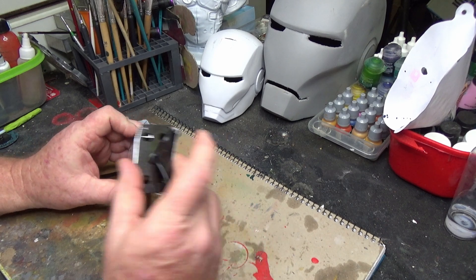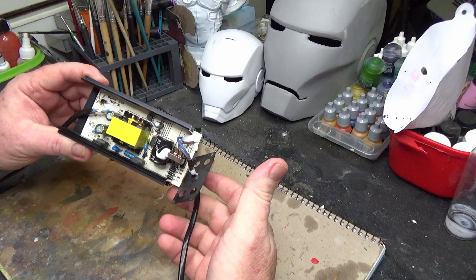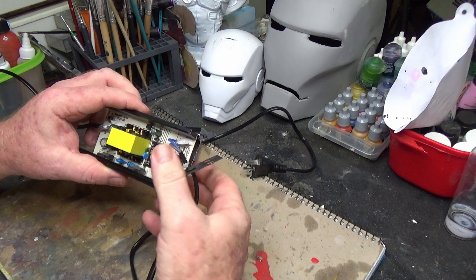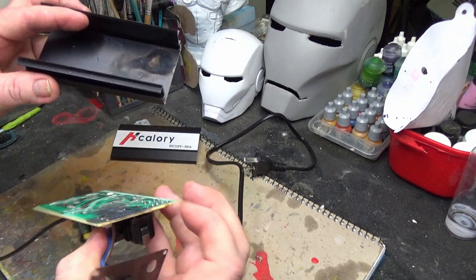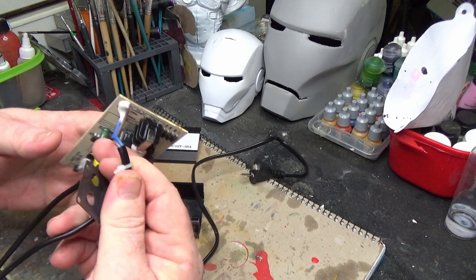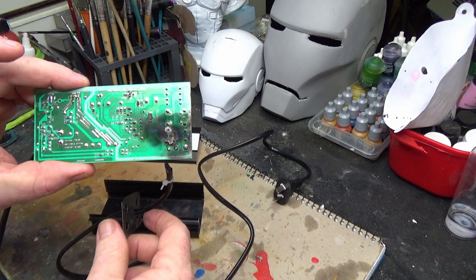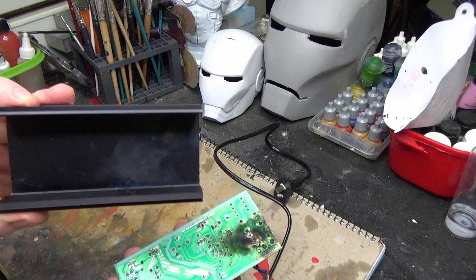So we're taking the screws out of that end, taking them out of this end. Here's the circuit board — looks all pretty normal really. This end is our 240 volt coming in this side here. Slide this board out and — oh, that doesn't look real good, does it? 240 volt goes in here with no earth, mind you. Hangs straight out the bottom of the circuit board. They put the bastard just straight in a metal container.